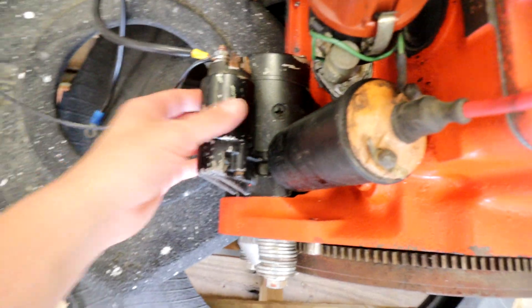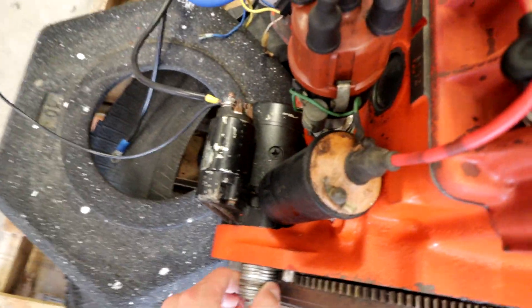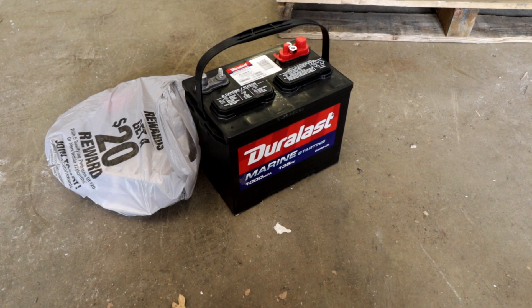I'm nervous because I don't know where to get another starter solenoid - maybe bring it to AutoZone and see if they have one, since it might be a standard one. We did look at the manual today too, so we're gonna try to wire it up correctly, which I think will help. And if we can get that to spin and it still doesn't crank over, then we gotta worry about ignition and fuel.